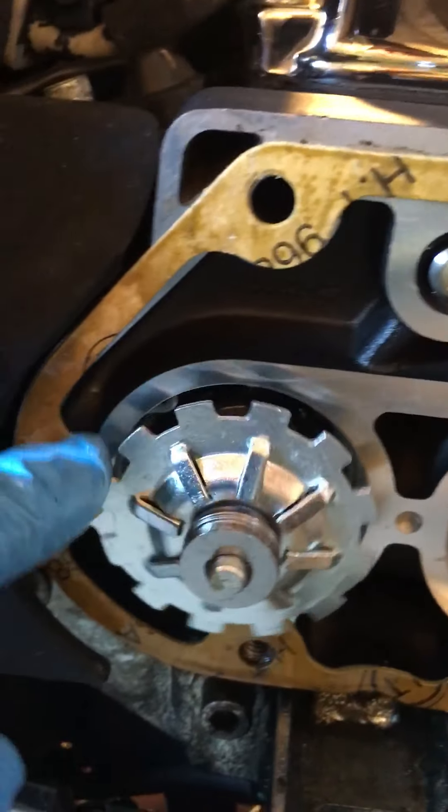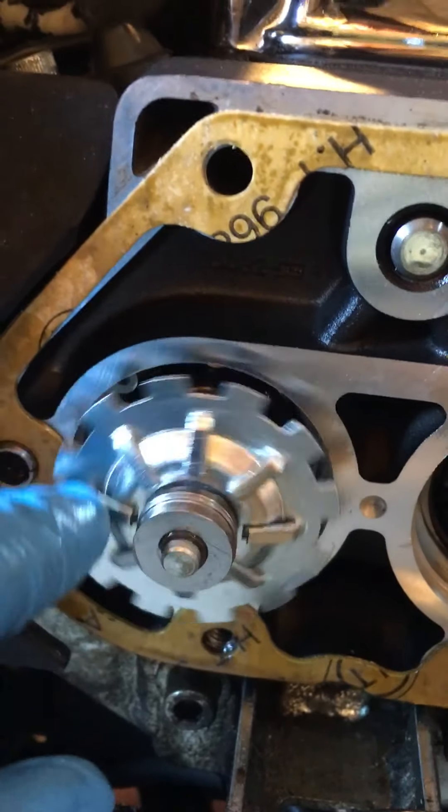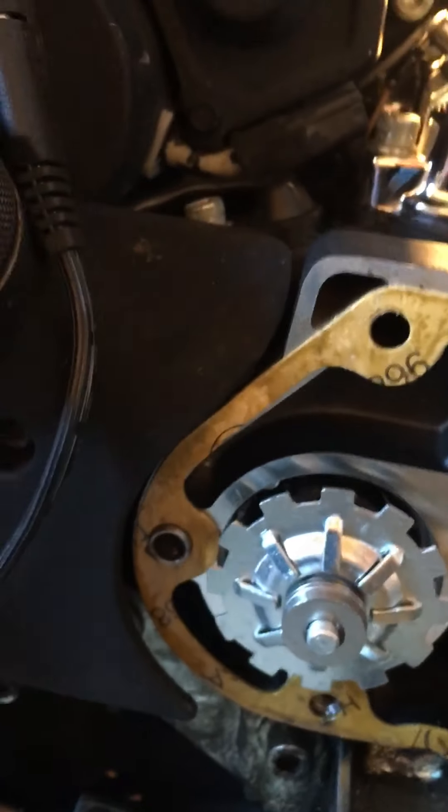This is why when you don't have the clutch pulled in and you hit the starter, your bike is going to lurch forward and you're going to look like an idiot. When you pull that clutch in, this comes forward and lifts that ramp just enough to push on that and push the clutch to free spin. This is super smooth, it's brand new - this is the V-Twin company version.